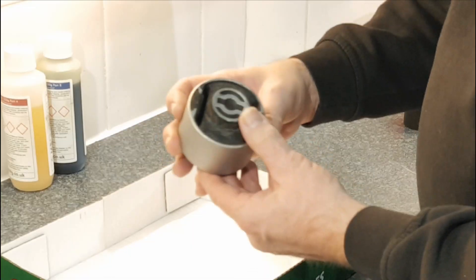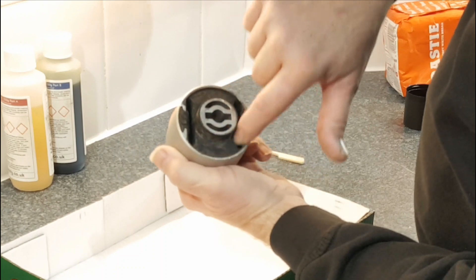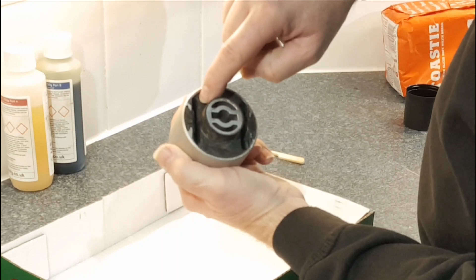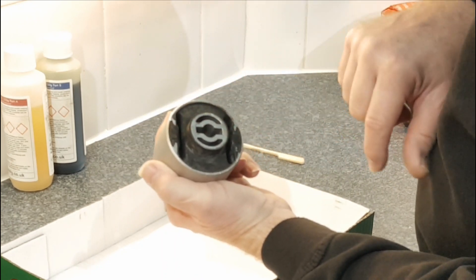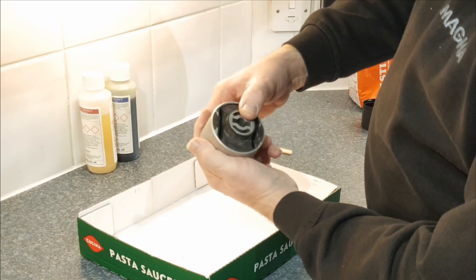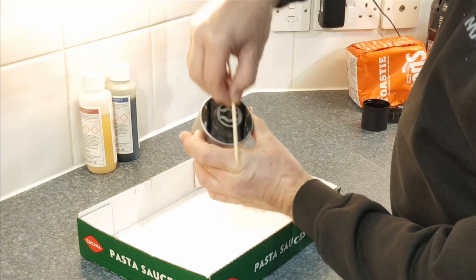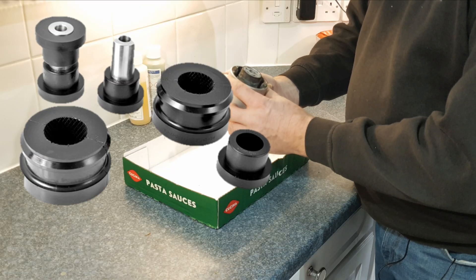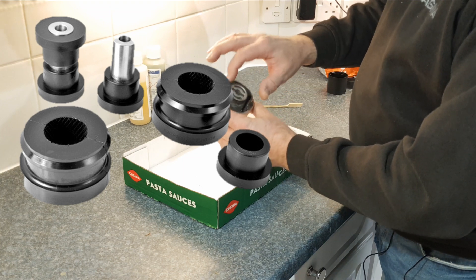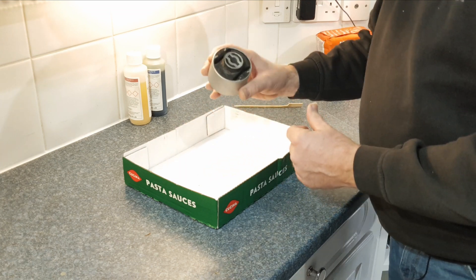This is a new bush, but the design is such that two quadrants opposite each other across the pivot point are solid rubber, and the two quadrants perpendicular to those are open. This design allows more movement in one direction than the other. You can buy ready-made heavy duty bushes for this position on the trailing arm, and those will do away with that difference in movement completely — and so will what I'm about to show you.